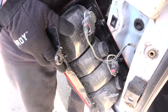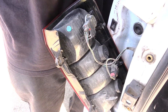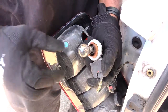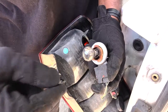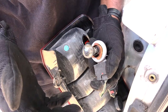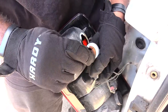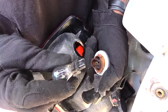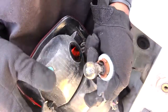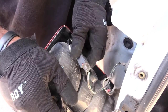To change out your actual brake light bulb, all you have to do is come right here, spin the socket like that and it'll come out, then pull your brake light bulb out like that. Stick your new one in and you should be good. Make sure you don't touch the bulbs with your bare hands because the grease can cause them to burn out sooner. It just pulls out like that, and once it pulls out, take your new one and plug it back in like that.